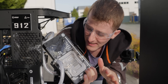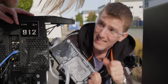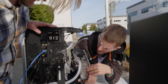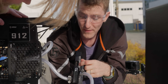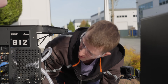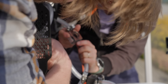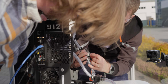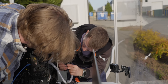To be clear, we're not criticizing EK — not for this, anyway. We were well over 200 PSI, probably 230 to 235, and I didn't even have it open all the way yet. The gauge doesn't go that high so we're flying blind. Bottom line, it's just a matter of materials and surface area. The other one with twice as thick acrylic probably would have done better. The metal CPU block didn't give any cares whatsoever — not at all. And this thicker acrylic flow meter cared about nothing, partly because its screws are secured into a metal faceplate.